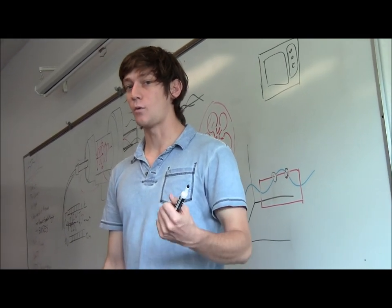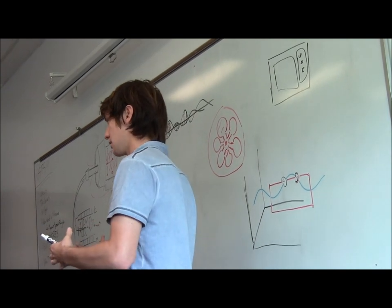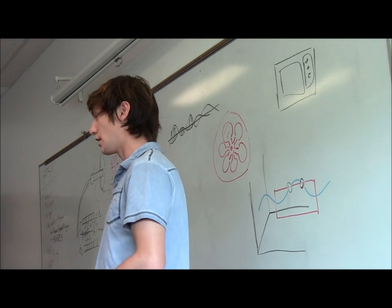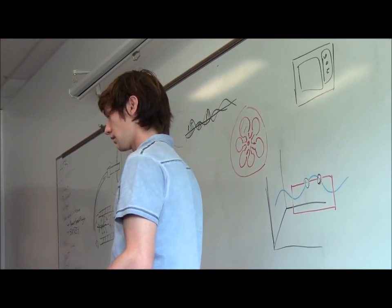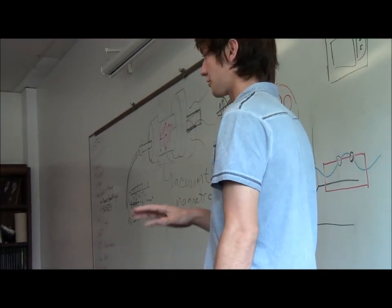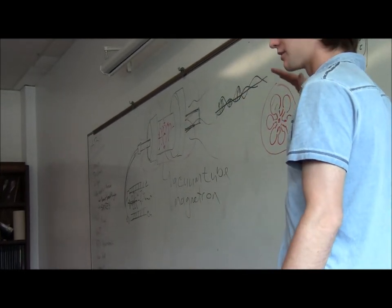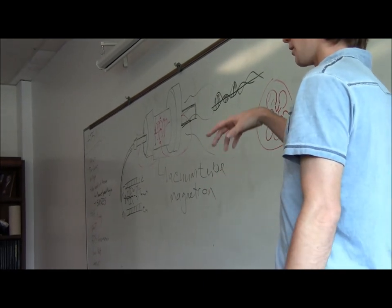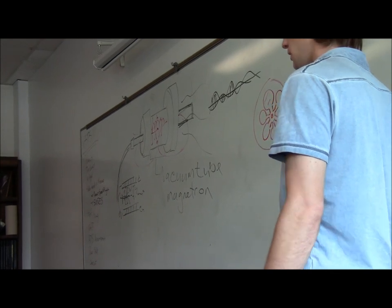Now, like you said, why does the inside of your hot pocket sometimes end up cold when the outside is hot? Or the other way around? Why does the inside end up so much hotter than the outside? Nodes. Not convection. Okay, yeah. So there's a couple of things going on here. The first is that, yes, it depends on where you place it in the microwave, but let's say you put it in exactly the center and it's rotating, so it doesn't matter. What happens is that depending on where the water actually is in your food, that part's going to heat up